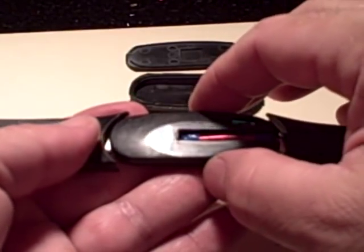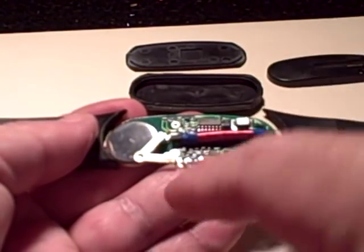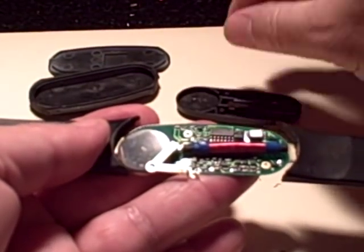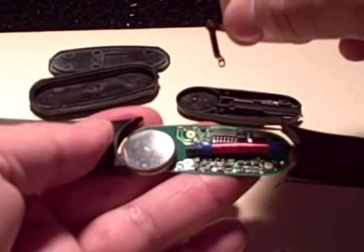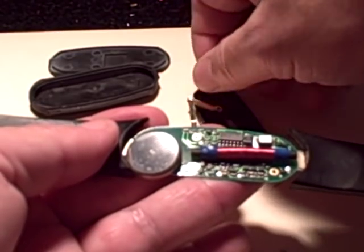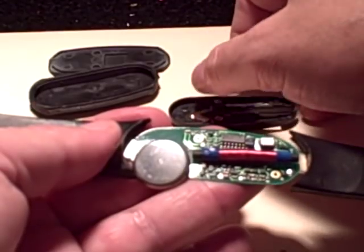Under the cover is where the battery lies. When you remove the three screws on the other side, this cover comes off, and there's the battery right there. Now it's got this clip that screws in, so you've got to make sure that clip goes right back into the cover just right when you put your battery back in.